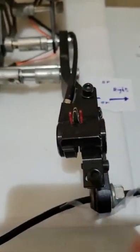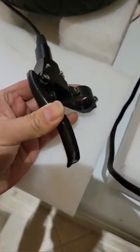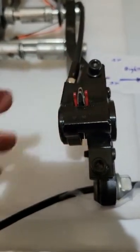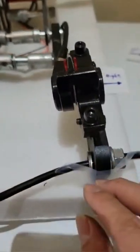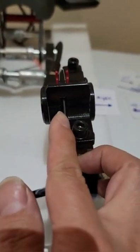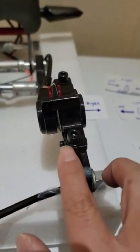So in the last video, we already know we can hold the brake, hold position, and then they will auto adjust to the right position. After you're holding, you just tighten up. Everything will be easier. Just a soft tight, and then double check underneath to look at the gap, and spin a little bit. If you don't hear any sound, that means it's perfect.